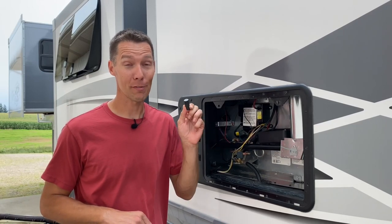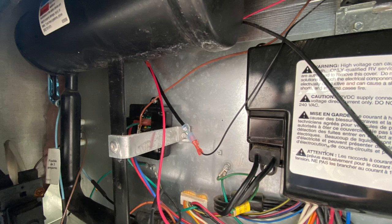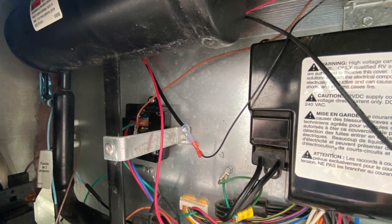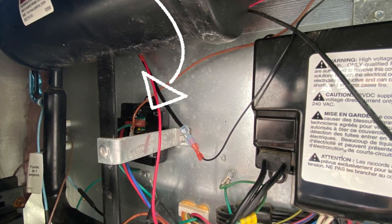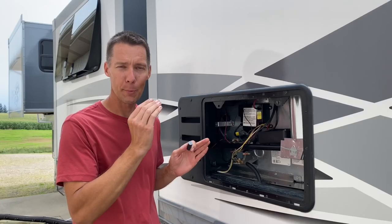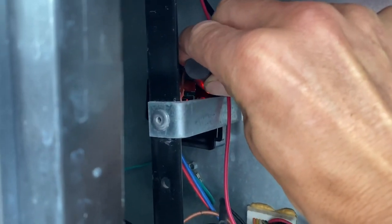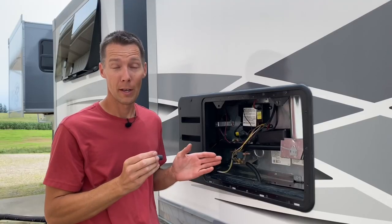If it's still beeping, go to step four — and this one is so easy it's a little mind-blowing. These magnets fixed my fridge for only four dollars. There is a limit switch on the outside of the RV with a red light on it — that's what's generating the error code inside. Mine is right behind the panel on the left. There's one screw in that switch, and just clockwise from it is a ball bearing that moves back and forth and triggers the limit switch. You use the magnets to drag that ball bearing back and forth to free it up — you'll hear it click — and the light turns off.